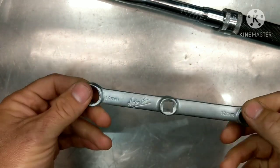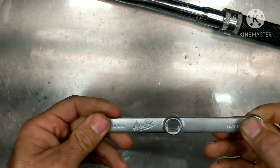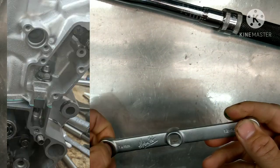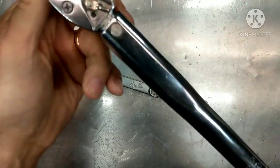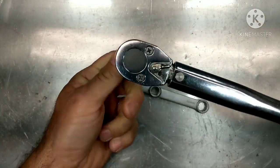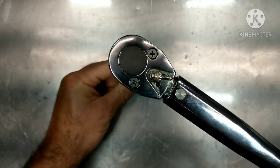You want to use something like this if you have a cylinder bolt that's inside of, say, a power valve — I'll show a picture here of a YZ250 that has it — and you can't get in there. You can't take your torque wrench and put it straight down to it. Whenever you're torquing something, you need to be directly above it; it needs to be straight.